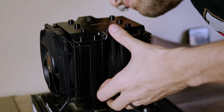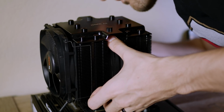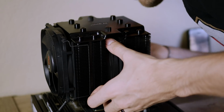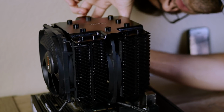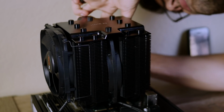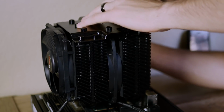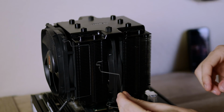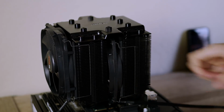Now, the way that we've kept things pretty mainstream and baseline here was I used the exact same fan curve for every fan in the case. It will remain that way for all the coolers you'll see tested in this video. So it's just a normal fan curve. It's a normal preset when you go into the hardware monitor fan utility, and that averages around 40 to 50% utilization for each fan. That varies per fan, especially when they're PWM controlled. 50% for one fan might be slightly higher or lower in terms of RPM than another fan that's a little bigger. And so that's something you need to take into consideration.